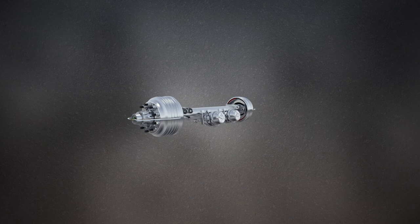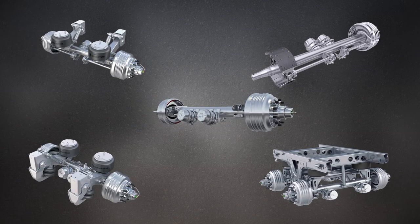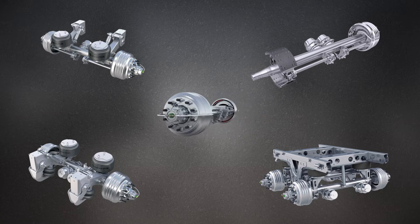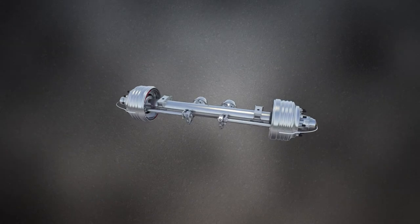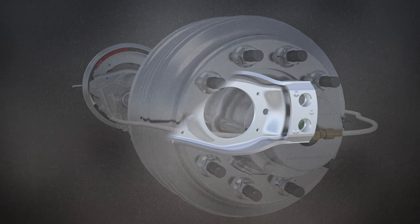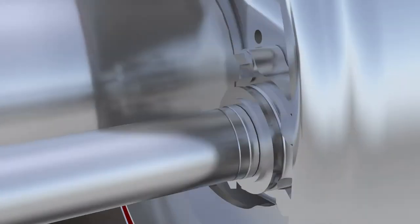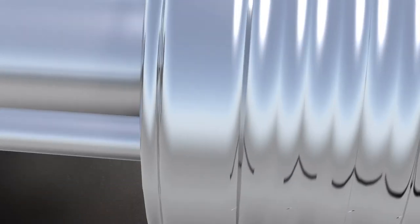Beyond the science of axle design, M-TEC 6 shares many exclusive features and benefits found on all of our trailer axles — features that make Meritor the leader in the industry. Meritor axles feature a unique stamped brake spider that delivers superior durability and is the lightest weight spider in its class. With our patented long-life bolt-on spider cam bushing assembly, standard on M-TEC 6, you can service the brake cams and bushings without removing the hub.